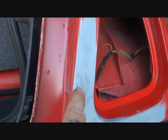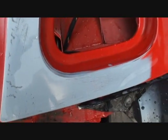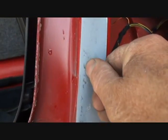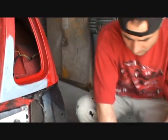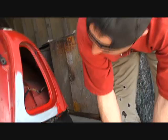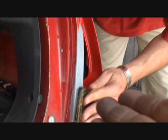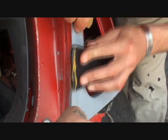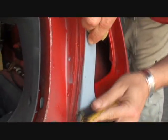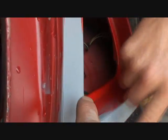What we're doing here is getting all the imperfections out from our primer. If you look right here, you can see some deep scratches. You can also see where the primer was put on very heavily. Rich is going to demonstrate how to block sand — wet sand — with 400 on a freshly primed area that's been sitting for two days. We put a guide coat on that, and he is sanding it out until there is no guide coat left. Watch him sand and you will see the black disappearing.